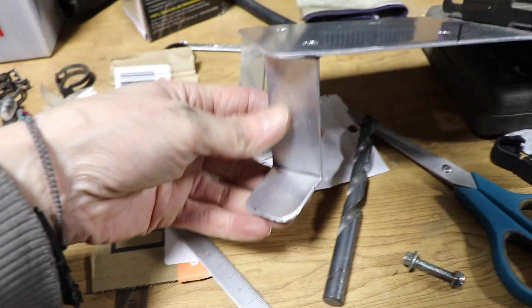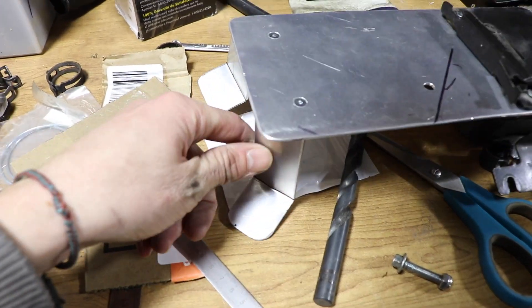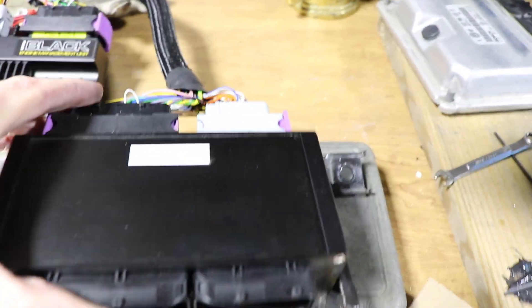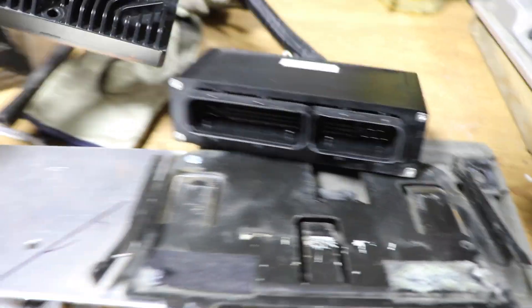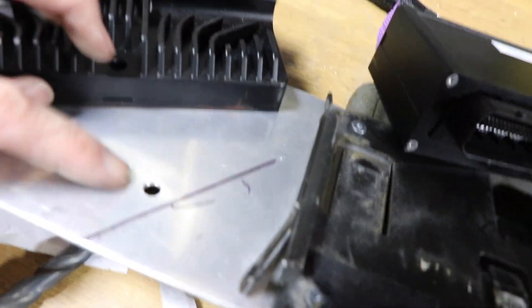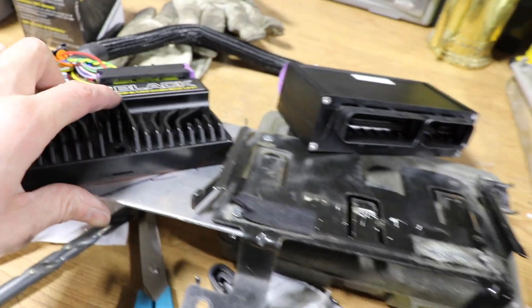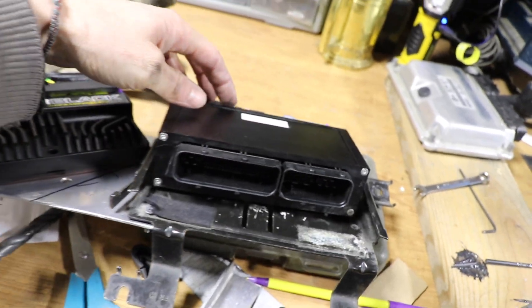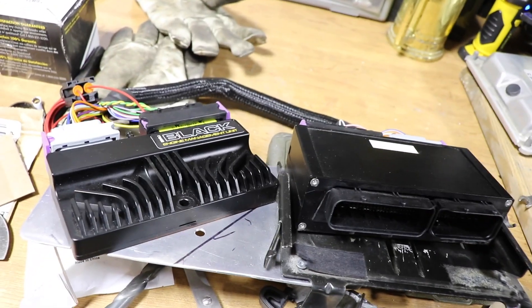This is what I got so far — the connector on this side, and you can see the aluminum piece coming over here holding the EMU black up off of the little firewall area. This is the little platform for the EMU black, because you have the R32 connector right there. It's just a piece of aluminum, and I got some flat head screws — one there, one kind of up under that — with a piece of felt, and on the back side I got nuts with washers. I also have flat head little 4mm screws with little feet that we're going to use double-sided tape on. We're going to clean the area really well underneath so it adheres properly. So this little connector is going to go here, and that hole is clearly going to line up — it's going to look something like this for the EMU black.